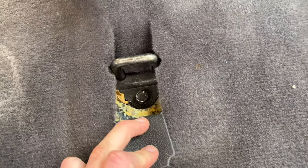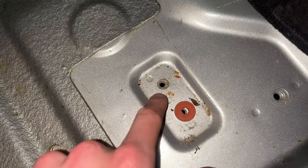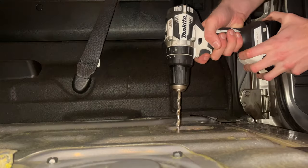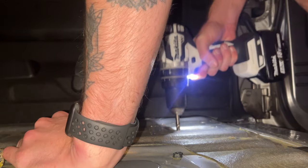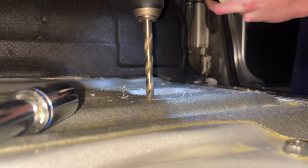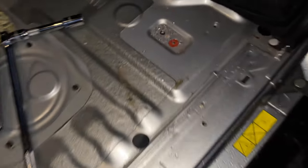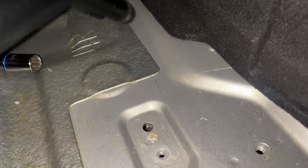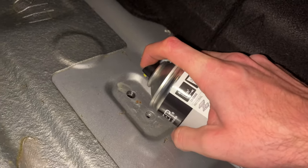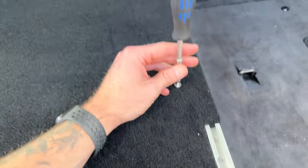Ideally, you don't want to be drilling any holes into the vehicle itself. However, I had to drill a couple of holes just to make room for these bigger bolts that I think are more suited to tying down the drawer. Once you've drilled the hole in the vehicle, make sure that you clean up the hole — no debris such as metal filings or anything like that. Also make sure you paint the vehicle as well so that it doesn't rust. Once the holes are drilled, you can start to line up the drawer.